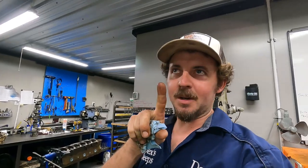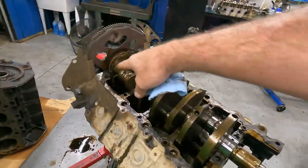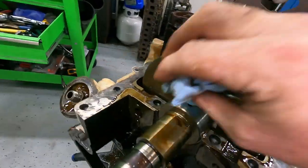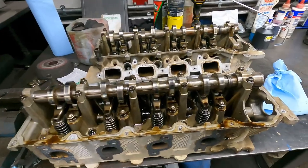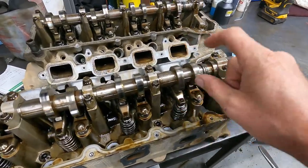I'm gonna finish taking it apart. I gotta get the HO heads sorted. Justin did find one millimeter — which he says is 40-over — so I've got my fingers crossed. The bed plate comes off and it's actually the main cap arrangement — definitely good construction, but a lot of trouble. I think the bearings look good. Just gotta get this thing down to bare block, then wash it. These are all individually stamped, so I don't have to track them manually. Those are the HO cams — gonna be careful with them.